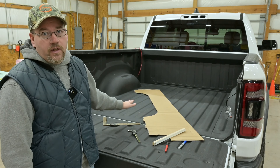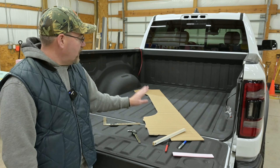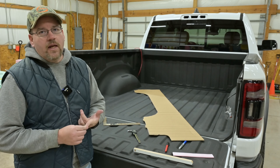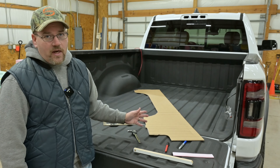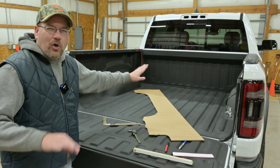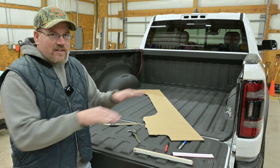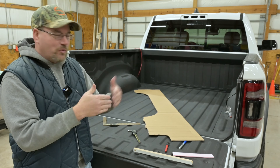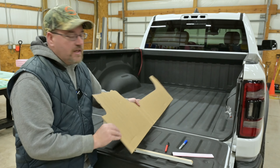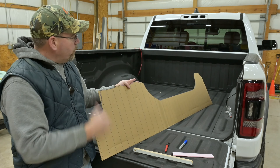Before cutting strips, I needed to address the weird edge spots, which pushed me into working on the template. If you've got a Toyota Tacoma or a lot of other trucks, this is a much easier job than with the Ram. The Ram has a lot of curves and compound angles, so the higher we build the floor, the tightness actually changes — you can't just run a stencil. To combat that, I took one of our solar panel boxes, opened it up to the full length of the truck, and put horizontal stripes across it.